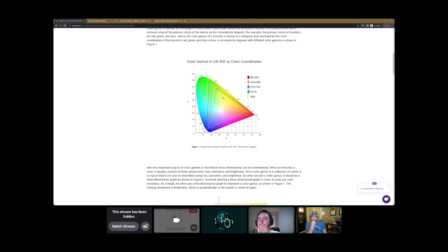It's like an ISO standard — you want a common space to work with. If what I'm looking at isn't really accurate, it's just going to make it worse when it goes to something else that isn't accurate. So if I can baseline what I'm working on and know what I'm seeing is accurate, then at least if it goes to another system, it's not as bad. Like the LH820SP projector we just released — it's got a Delta E of less than two, which basically means it's pretty much spot on with that color gamut. And that's just factory calibrated out of the box.